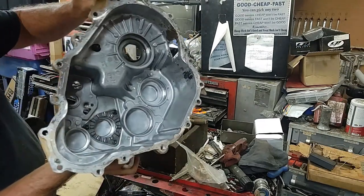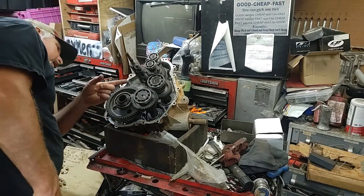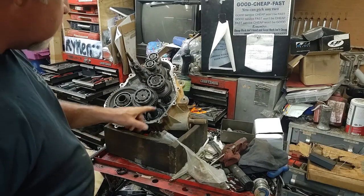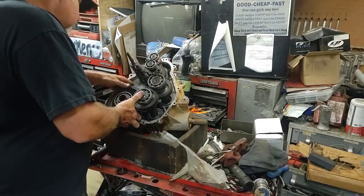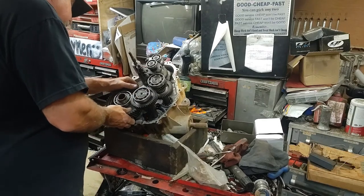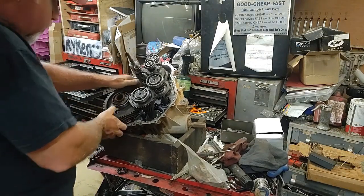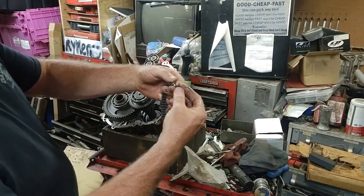And as you can see the damage there - a pretty sizable hole in the case. What happened is the chain wraps around here, and the broken piece got under this gear here and just popped a hole in the case. I'm going to clean this thing up - it's just got RTV on it that seals the case up. I'm going to try to slide this gear out; I'm pretty sure it'll slide out without removing anything else. Actually, the piece of the chain is still down in here - so there's your chain, broken reverse chain. That's the culprit.